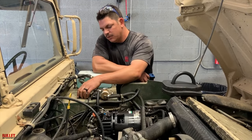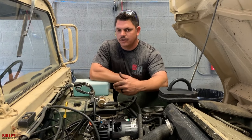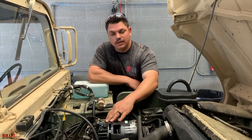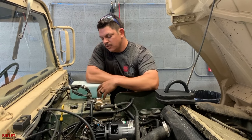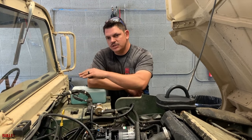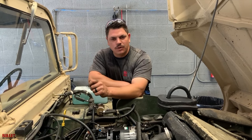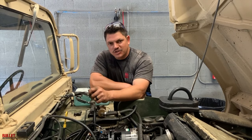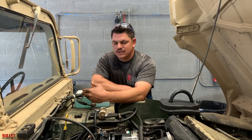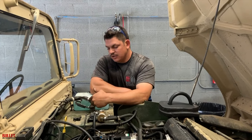You're going to take these shunts off here — take your protective cover off. Don't forget to disconnect your batteries because you could fry your computer. If you still have draw after disconnecting the alternator with your starter hooked up, you're going to go to your ECM and check it. One quick way to test your ECM is to have it in the off position and have someone touch your battery terminal — take your negative terminal off your main harness and touch it. Usually you'll hear the solenoids click inside. If the solenoid is clicking with the ignition not on, that means your box is bad.